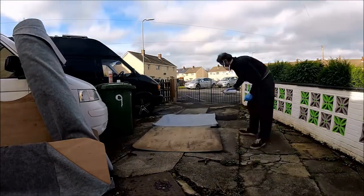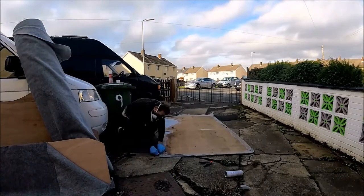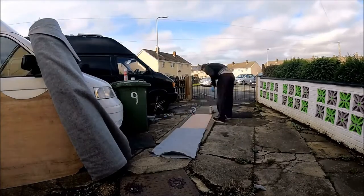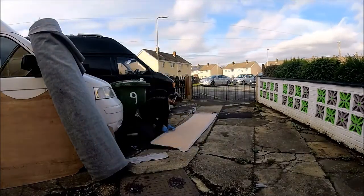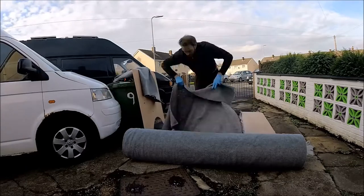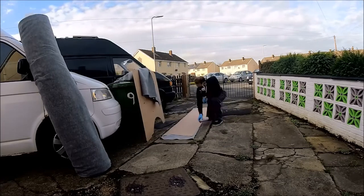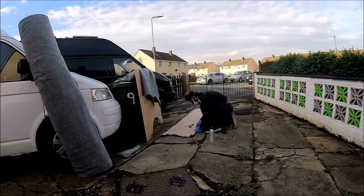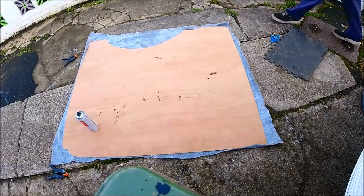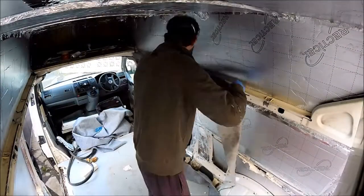For carpeting the ply panels inside, the easiest way is to do it half and half. Cut the stretch carpet to just over the size of the panels, fold one half down, spray the ply panel and the carpet, apply that, then fold the other half back and spray again. Doing it half and half means you can't get overspray on either side. The headlining was also carpeted from new ply panels using this same technique - once done, spray adhesive all the way around the edges and trim it back.